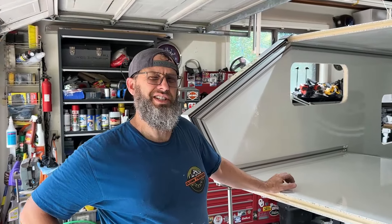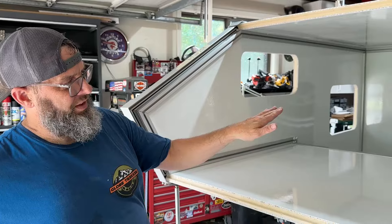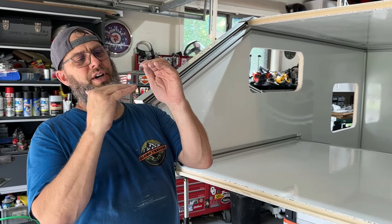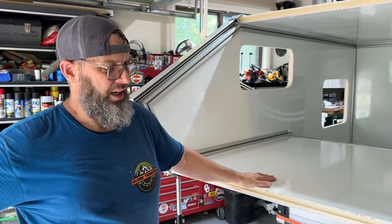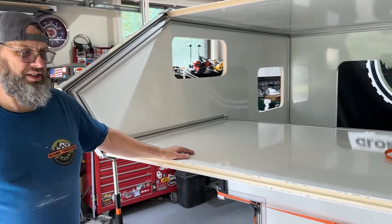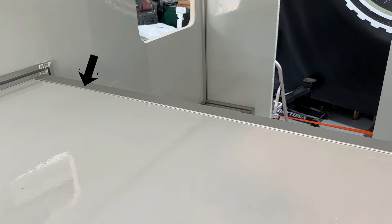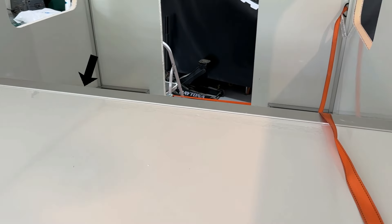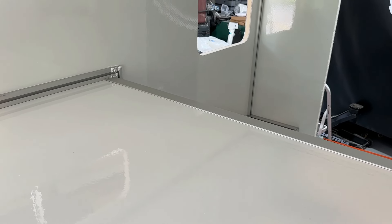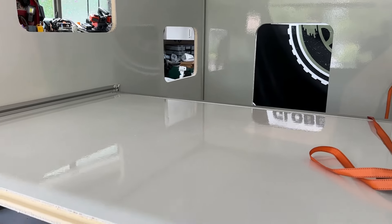Maybe the hardest piece yet, without much surface area, to get this panel up in that extrusion. Get that extrusion angled down just a little bit. Use a putty knife to get that to jump into the ramp. Come-alongs and little jacks here are our friends — just use a little mechanical advantage. That inside extrusion is what you have to rotate forward, rotate it down a little bit. Finesse it in.